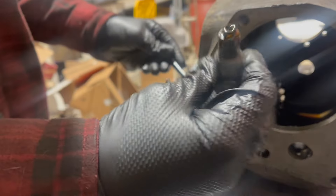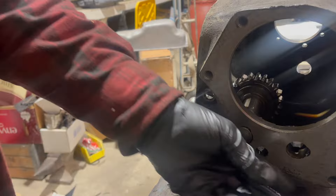Time to remove the reverse detent. I'll take the cap out with the 13/16 socket, holding the body with an inch and an eighth wrench. Then I'll pull the body out, and there will definitely be a detent ball and a spring sitting in the bottom of the transmission. Magnet - yeah, that little fella.